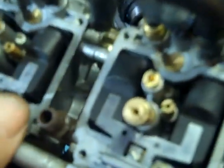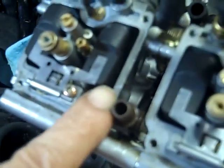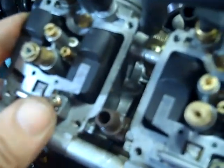With a little bit of trial and error, I bent these little tangs right here and right here - I did each one of them individually until I got it so it shut off at a perfect 90-degree angle. The way I find the 90 degrees is I placed something right here on the edge of the float and measured it, then I measured it right here so that it was the same measurement front and back. Once it's the same measurement, then I have my 90 degrees.